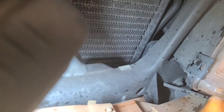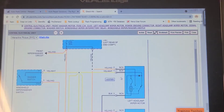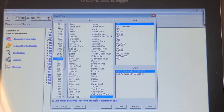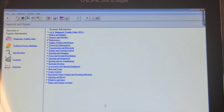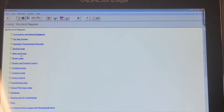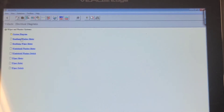I don't know where the wiper motor is — we'll have a look. On the schematic, the left headlight motor shows a yellow-violet, a yellow-white, and a black wire — a three-wire plug. I think I've located that. I'm going to check to see if I have an OE version of this diagram.